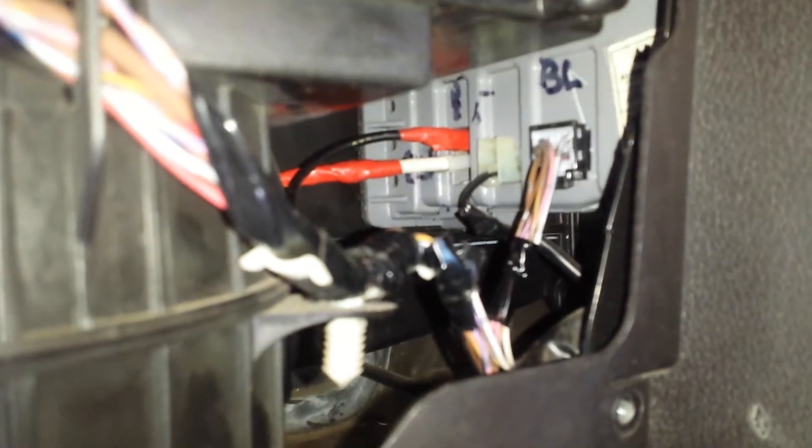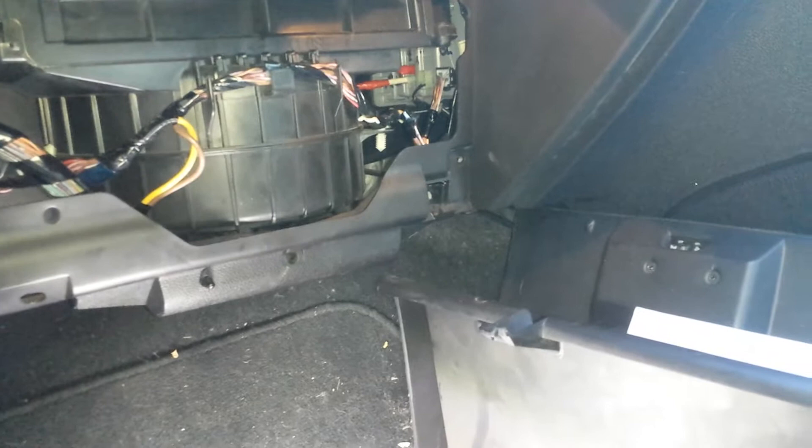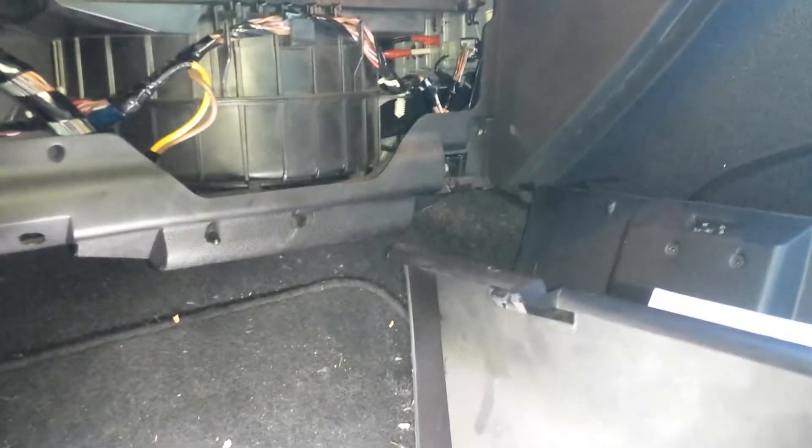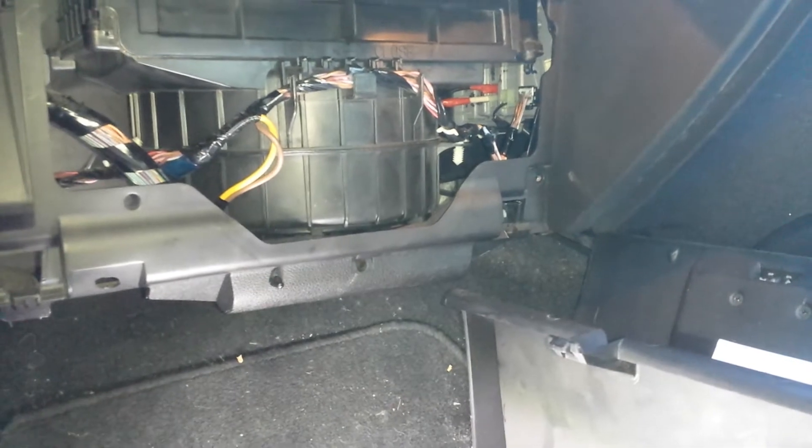After cleaning up the plug, I remove the plug and put new spade connectors on the cable going to the blower and plug them in without the actual square plug, so there's no clip holding it in. But they're quite tight, so I think it should stay there.